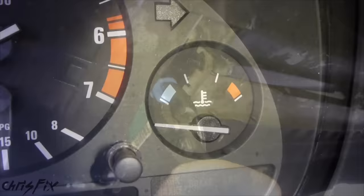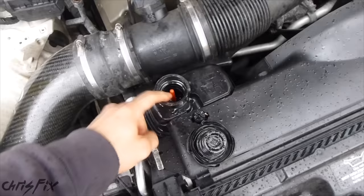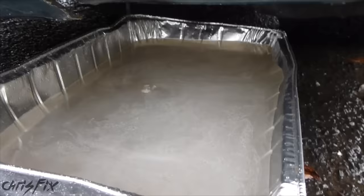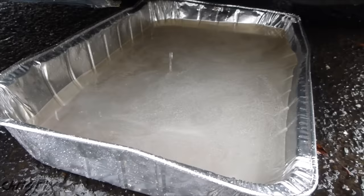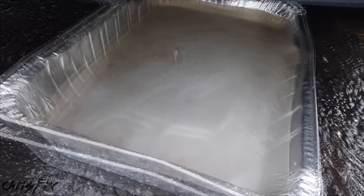To have the coolant come out faster, take off the radiator cap, or in this case the reservoir cap — that'll allow air to come through so there won't be any suction. If the water stops draining and you don't think you got it all out, start up the engine. This will cause the water pump to force out any remaining water into the radiator so it can drain. You can give it some gas. We got most of the water out, which is good. You can see it's pretty clear — we went from this coming out of the radiator to that, which means our cooling system is pretty clean.